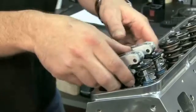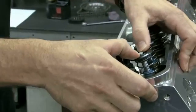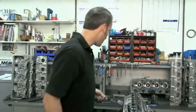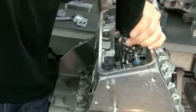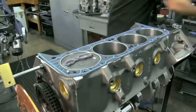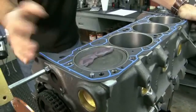Get all this stripped off. You'll notice we've got checker springs — these are pretty lightweight, just makes the engine easy to turn over, but no problem using your stock springs, it just takes a little more effort to get the engine to spin over. Get this head bolt out, pull the head off, and see what we've got.